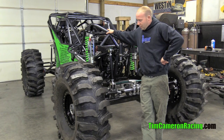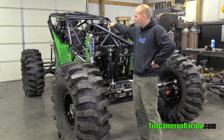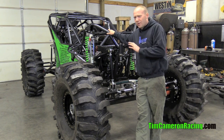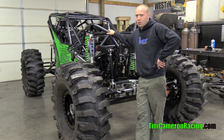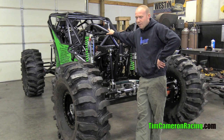And really, other than the leading arm, I mounted the radiator behind the fuel tank to keep from heating the fuel. I've never really had a fuel boiling issue, but at the same time, I don't trail ride as long as I used to either. It still ain't ever good to heat the fuel, so that's something I did different.